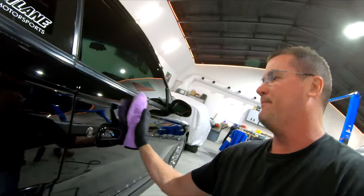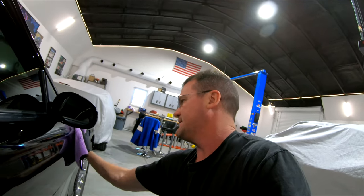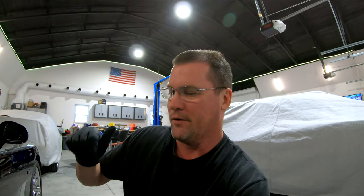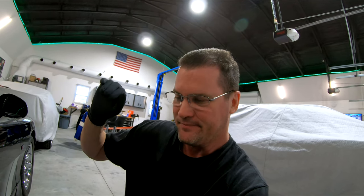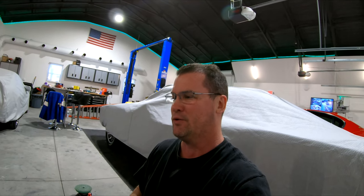I spent yesterday getting the air conditioning working — that's one thing I didn't have working before. I found out my CCRM, the Constant Control Relay Module, was not sending voltage to the compressor. So instead of digging around with that more, I decided to hook up two relays. One relay — the feed wire going in is triggering a relay that sends 12 volts to the compressor and turns it on. Then another relay triggers a ground connection that's tapped into the second fan from the Holley. So whenever I turn on the AC, it turns on the second fan which pulls air through the condenser. Right now it works just like factory — you turn on the air conditioning, the compressor engages, the second fan turns on to keep everything cool, and it runs great.